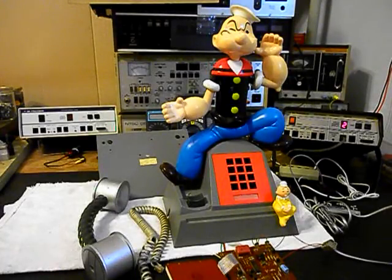Not only that, this unit has a piezo buzzer, so we're going to be going to a small bell. We're actually going to install a bell also instead of having the piezo buzzer sound — the electronic noise that you would hear with an electronic type telephone. So we want to go ahead and show you the main PC board.